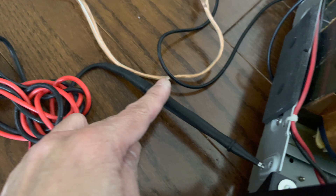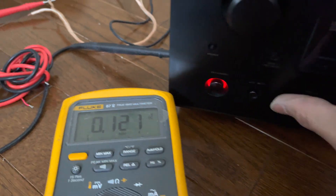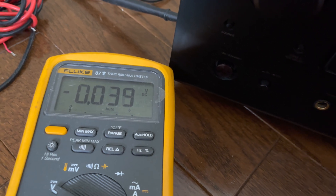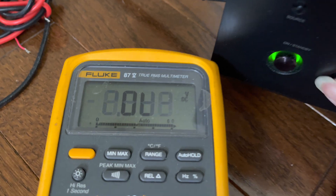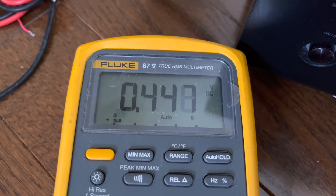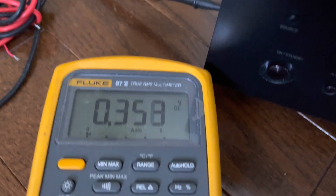I put a needle on the very first connector wire to probe it and connected the wire to my positive probe, as well as the negative probe to the body chassis. I'm going to show you on power-on again what the problem is. It's the very last wire facing the front, which is supposed to give a positive 15 volt on power on. When I press the power on button, you can see it goes as high as 8 volt but then slowly drops to 5 and 4 volt, showing there's a problem with the power rectifier.